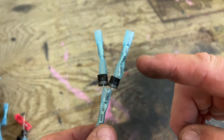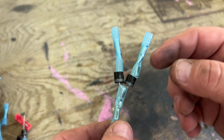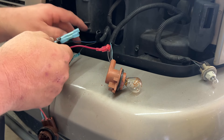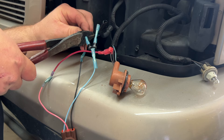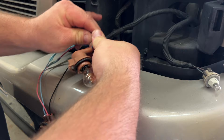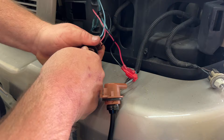This is what it looks like now — we haven't got them crimped in there yet. I did have to take a little bit of the diode leg off, but I wanted to make sure the butt connector would really slide all the way up to its diode so that when we shrink it back down, everything is good to go. We've got our end — we're going to go ahead and place this on here and crimp it in. We've got this blue wire here — let's go in here as well. We need to take this other one and go to the blue wire there and we'll be done. That's in there. Pop this light out — next we're going to get these plugged in. That one's in as well.